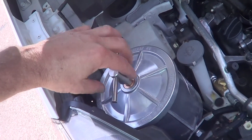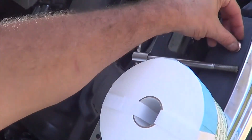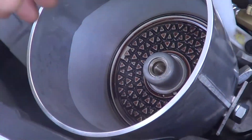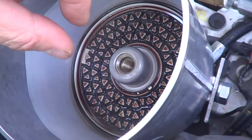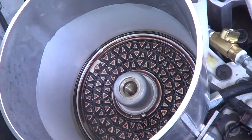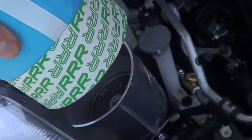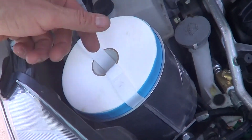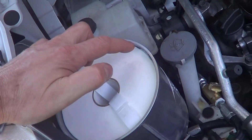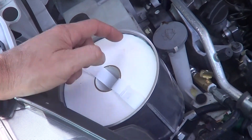It goes in an enclosure, which basically looks like this. I've just installed it but haven't put it online yet. It's still bypass filtration. The oil has an orifice — it comes up through the middle, then goes down on the sides and ends up passing lengthwise through the filter. It seals on the outside edge and pushes in pretty tight. It also has the advantage that you can actually examine the top and see what you're picking up, because the entrance to the filter is that top layer.